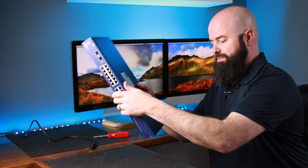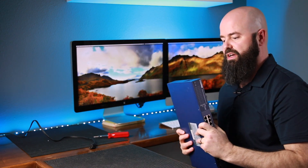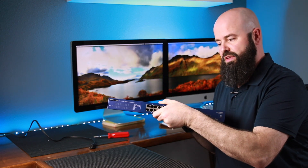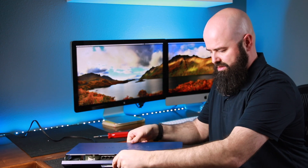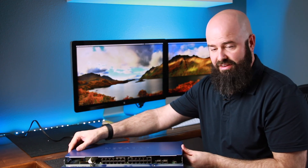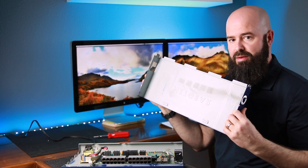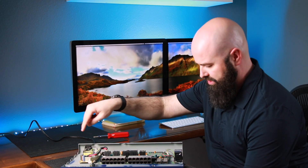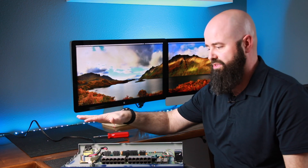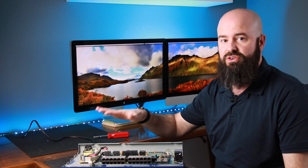Be real careful because it can fall apart on you right now since it is undone. Remove the front panel and set it down, then slide forward to remove the top cabinet. Be really careful while working in here not to touch the items on the right side — this is the power supply and it can still be energized even though it's unplugged.